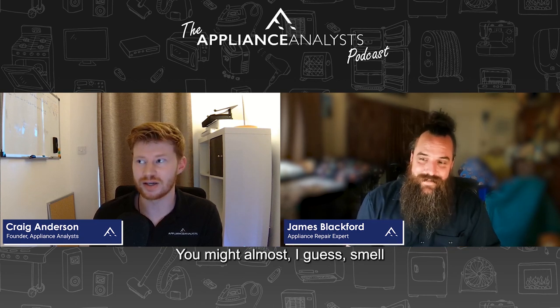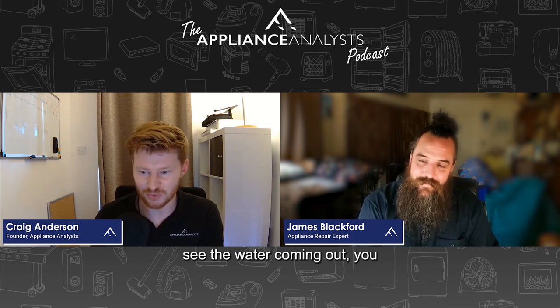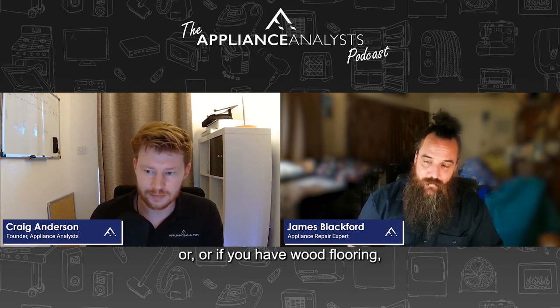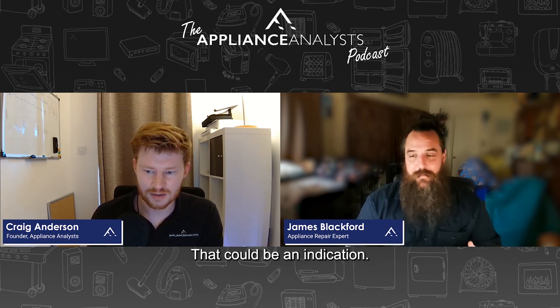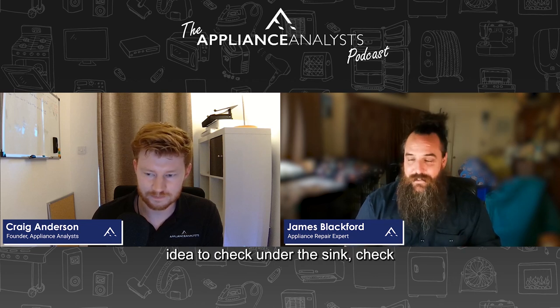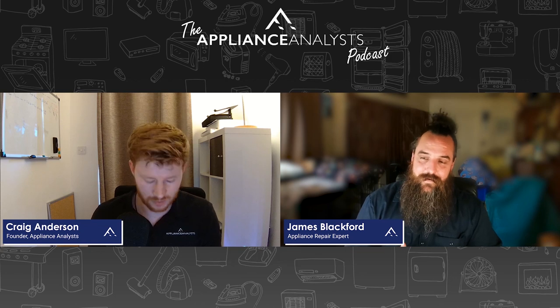You might almost smell the floor damage before you see the water coming out. And if you notice any tiles or wood flooring that seems to have any raised spots anywhere near the dishwasher, that could be an indication you're having some water leakage there. So it's not a bad idea to check under the sink and under the dishwasher, make sure you don't have any water leaks. Yeah, really good to know.